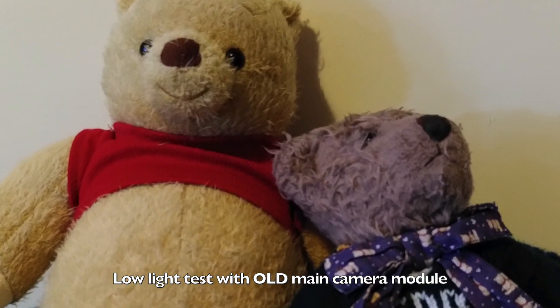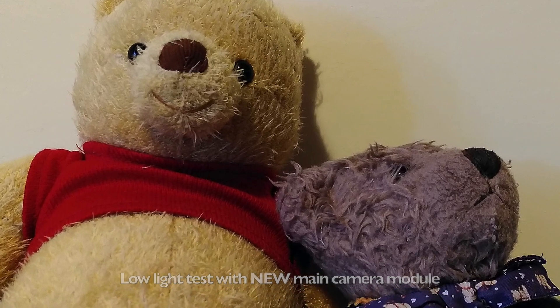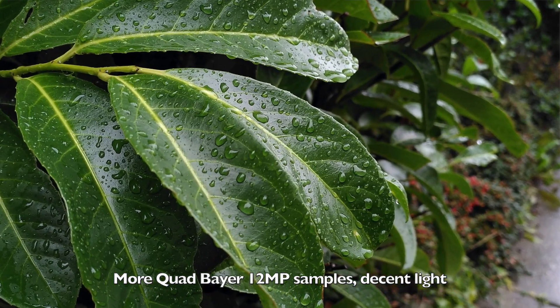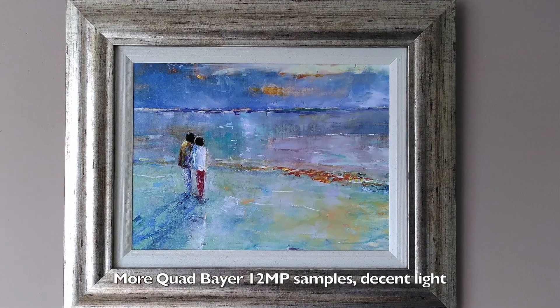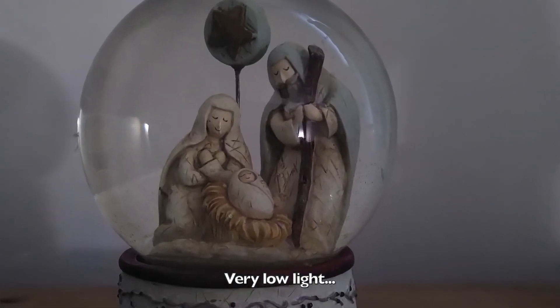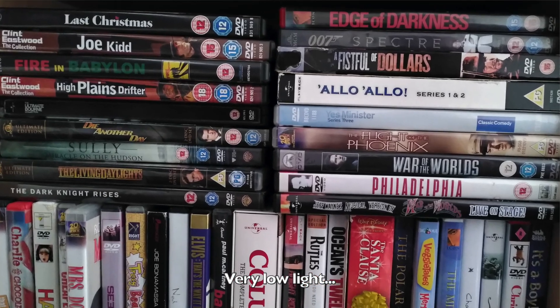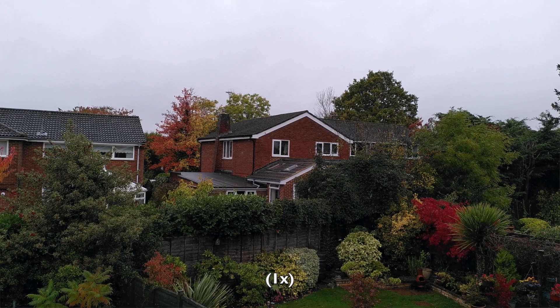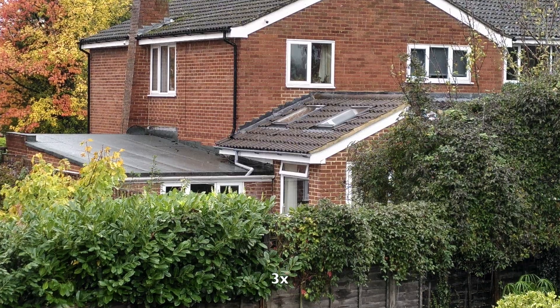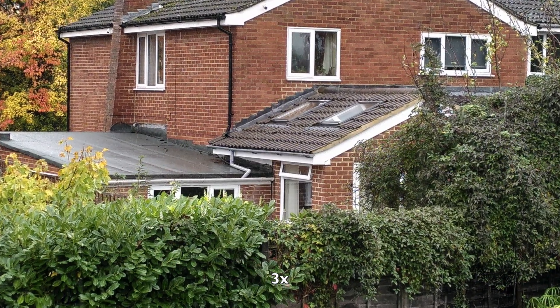Time to fire it up and test the new cameras. See the example photos here. Fairphone doesn't give exact details of the new modules, but GSM Arena did some digging: the main camera is a newer 48 megapixel 1/2.0 optical format sensor, versus the original 12 megapixel 1/2.5 inch sensor. Nowhere near flagship camera specs, of course, but results are still pretty good for a Fairphone and a big upgrade from the original. Zooming is possible to the usual caveated degree with quad Bayer sensors — 2x is okay. Video isn't up to flagship quality and only has mono audio, but it is stabilised and goes up to 4K resolution.